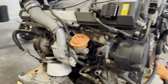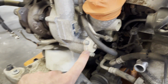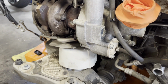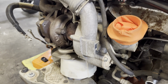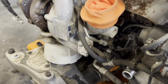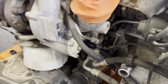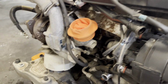So rarely also, these are your diverter valves on the turbo. There's a little diaphragm in here and spring, along with this plastic cover that controls the wastegate diverters on the turbos. And in really hot climates and with some age, we have seen these diaphragms start to tear and you'll lose boost pressure. So we went ahead and renewed those.